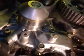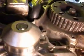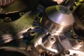And then there's the beautiful water pump. So you're going to have to loosen all those bolts, going all the way over there, all down around here. Looks like there's about 14 of them to me. And then scrape your surface clean with an appropriate knife or something like that, and put a new gasket in, and then reinstall the bolts and torque them appropriately as the book requires.